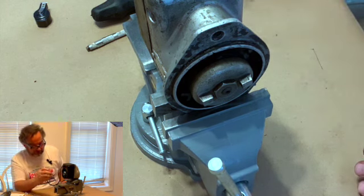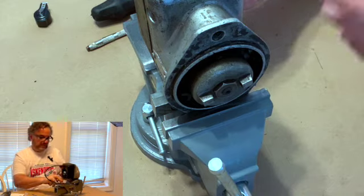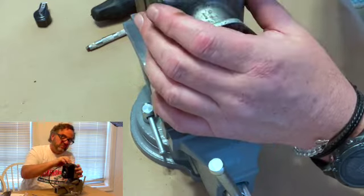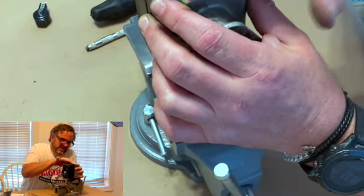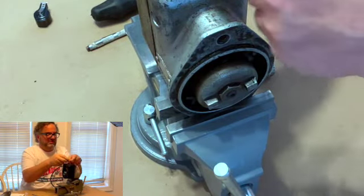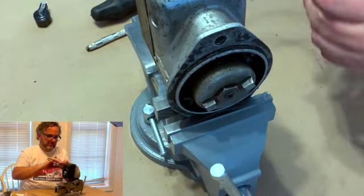Now, if you hold this, you won't like it. But what you can do, if everything's clean, you can do it like that because you're making a connection through the vise. The safest way is just to, this has been painted, so I'm gonna scrape us off a clean place here. And if we've done it right, and everything's good, see, we just took the paint off. If it's right and we've done it well and got everything back within tolerance, you can hold this down.